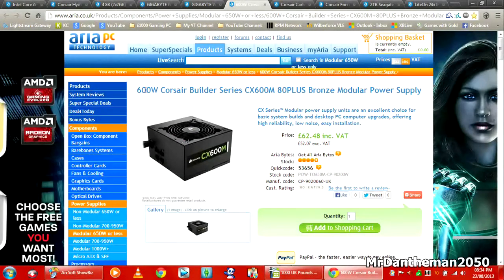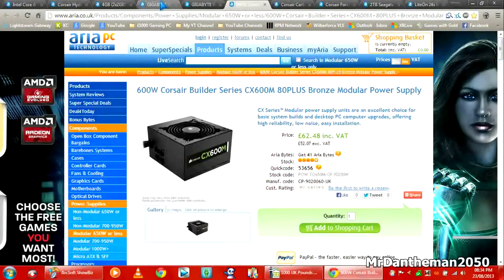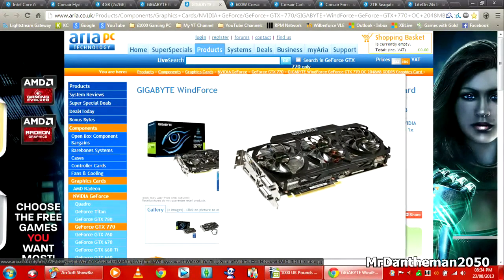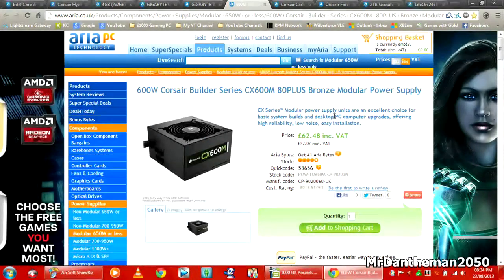Since we're getting such a powerful GPU, we're going to need a 600W Corsair Builder Series — the CX600M, 80 Plus Bronze Modular Power Supply. It is modular, so we don't want a load of cables hanging out the back. We're going to get a nice big case so the build looks nice. It won't be cluttered and you'll have a lot of airflow, because this graphics card is going to pump out a lot of heat — it's got three fans. So you want a nice modular power supply with not a lot of cables. It's 80 Plus Bronze certified, so it's not going to blow up anytime soon — Corsair makes good stuff.